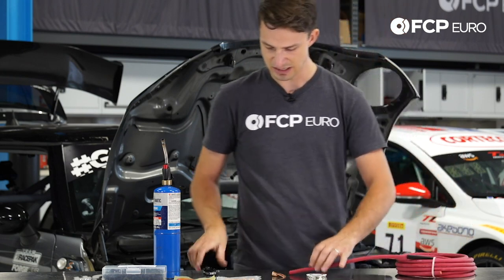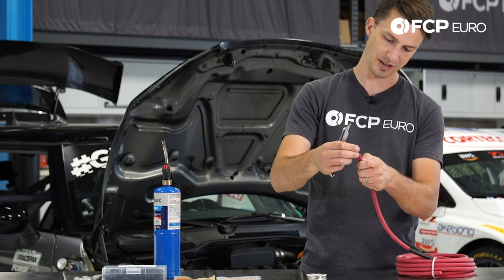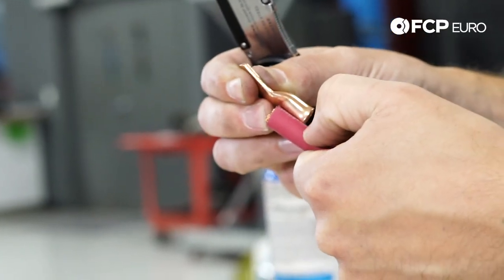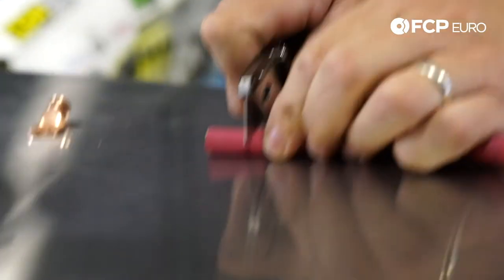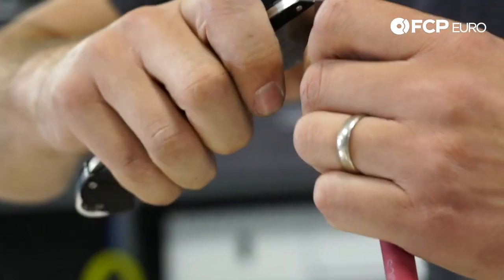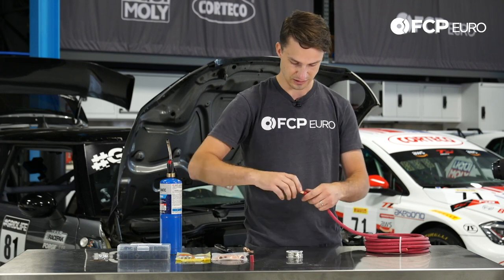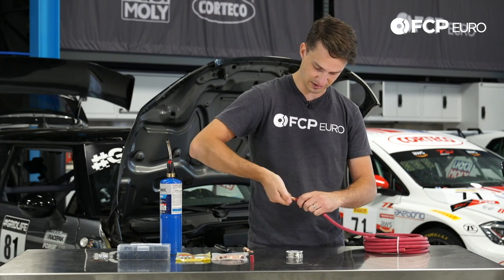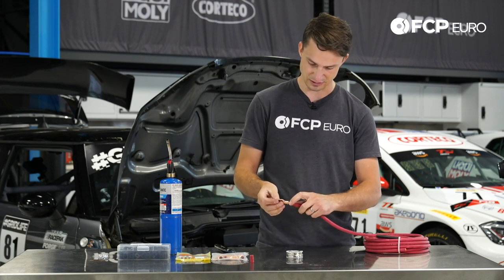Shrink wrap's down. Now I'm going to take a razor blade and just nip the same distance off the end — a little bit more than that, maybe three-quarters, like where my thumb is. Just cut it with the razor blade and then spin it right around. This cable is really nice — it has a nice thick coating so it's going to be really safe in the car and not short out. Then we can just pop the end right off like that. Now we're going to slide the copper end on — these are just normal copper ends, pretty simple stuff. Make sure all the strands get in there — a twisting motion does really well.